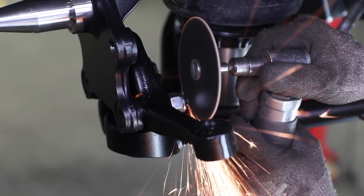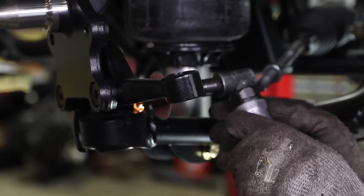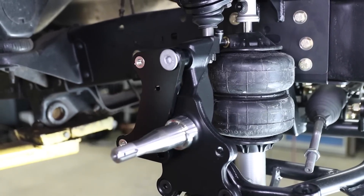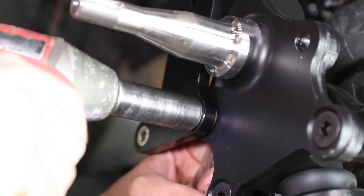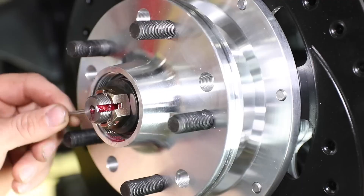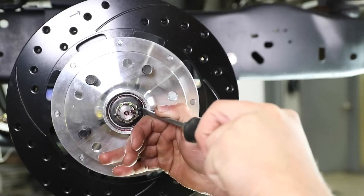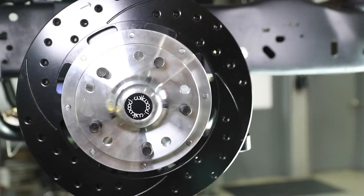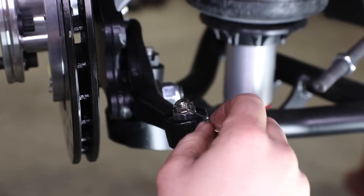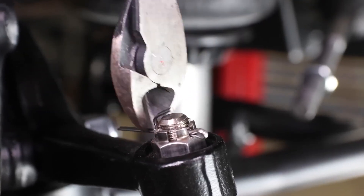We made our front system with a 63-and-a-half-inch track width, so you can use traditional offset wheels to keep those classic truck looks. When compared to other salvage yard options or street rod-sourced front suspension systems, the RideTech system is significantly more structurally sound and provides uncompromised suspension geometry for vastly superior ride and handling, with the simplicity of keeping your factory frame.